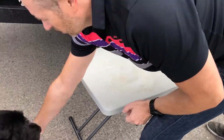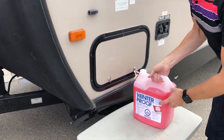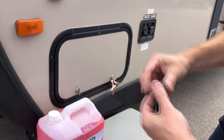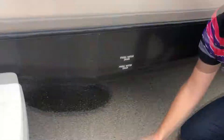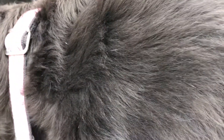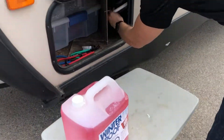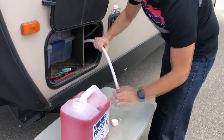I like to set up a table because we're going to be siphoning the plumbing antifreeze through the entire system. Before I get to that — when I leave it just in between camping, I don't like the water to get stale inside, so I take out the low point drain caps so the water can just freely dribble out. I'm going to put these back on just while we're cycling this through. This is a direct line to the pump, so we're going to put that in here and take off the cap.